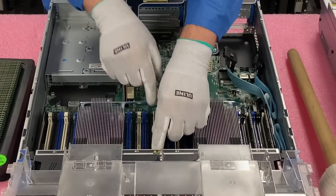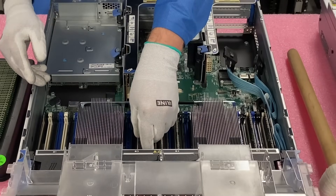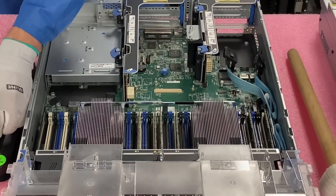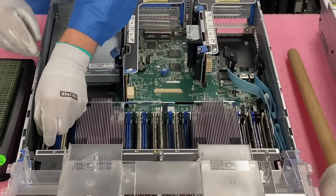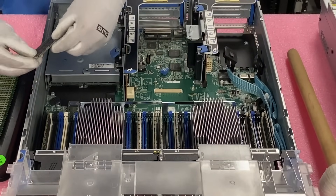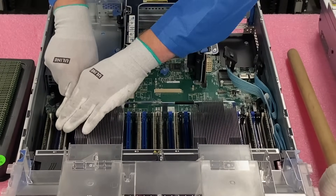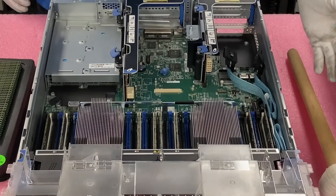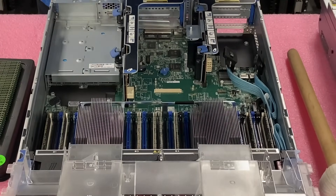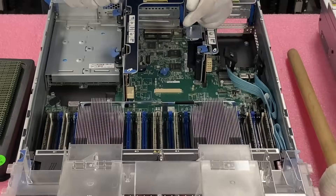This side is flip-flopped from the other one. So again, A12, B9 — just such a strange numbering scheme. Now we're going to come back over here to C1, and then D4. I'm going to stop right here in the interest of time, but if we were to continue forward, it would be the black DIMM slots and then the blue. If you're filling them all up, you can load them in any order. This is more focused on if you're not maxing it out — which slots to use to maximize your memory channels.